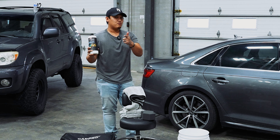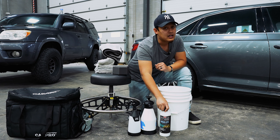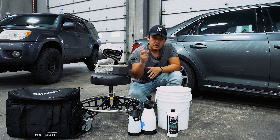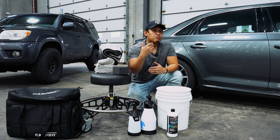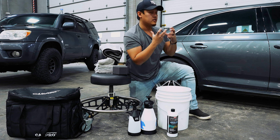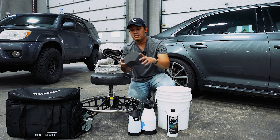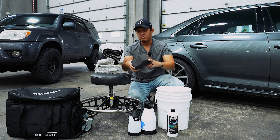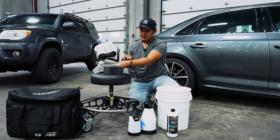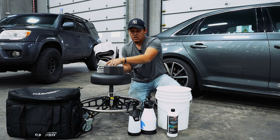This is perfect and amazing to use on lightly soiled vehicles. So what are you gonna need for the rinseless wash method? First of all, you need your solution — we're using P&S Absolute. Then we're gonna use a pump trigger and a normal IK trigger sprayer for a pretreatment of the vehicle before the contact wash. We got a bucket full of water — about four gallons. You're gonna need your UBS Ultra Black Sponge from the Rag Company, a gauntlet drying towel, and four gray creature towels for the wheels.